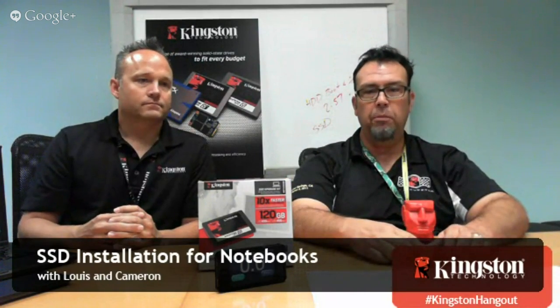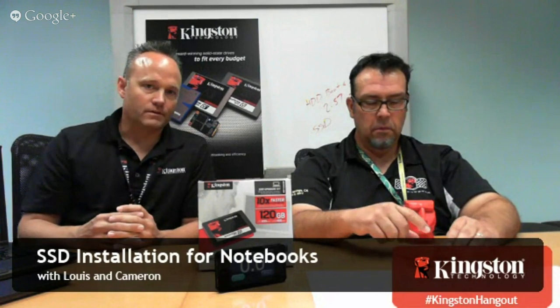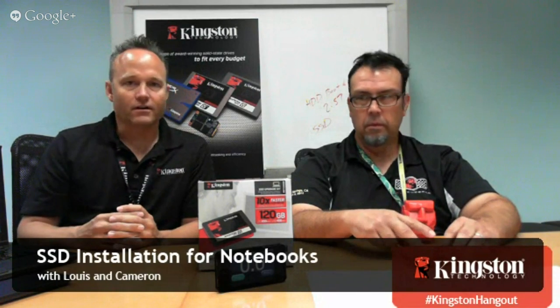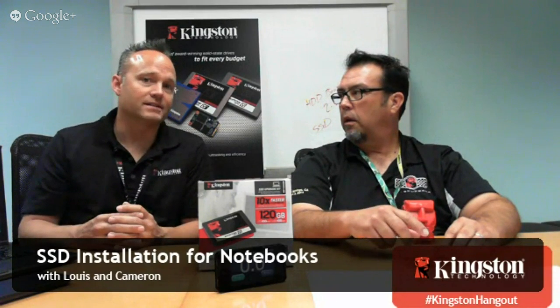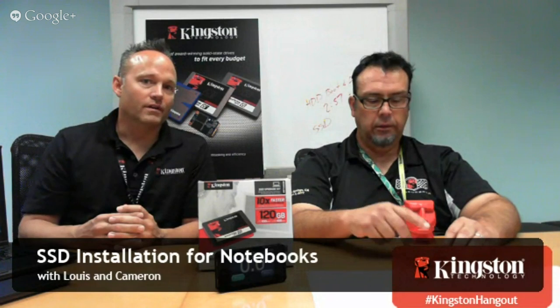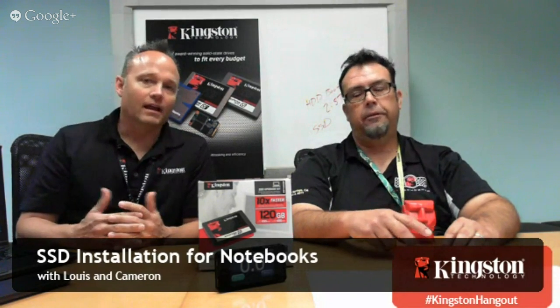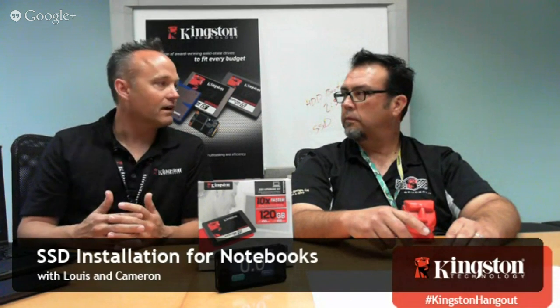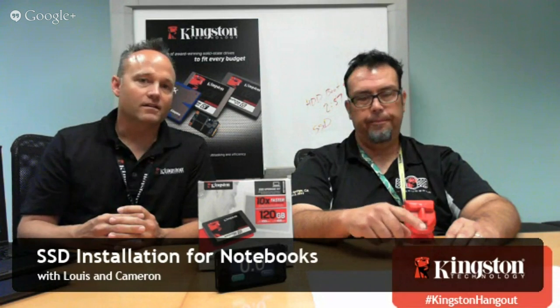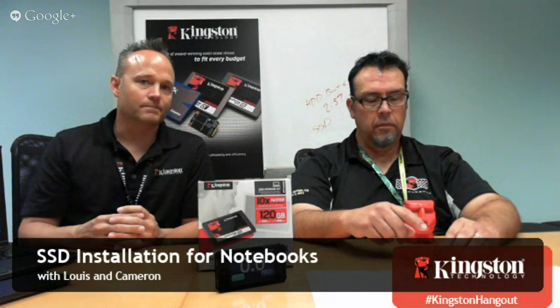I think with most SSDs, you'll see really good random read performance and random write. And then the other thing, to put some perspective on bandwidth performance with SSD compared to hard drive: with the latest generation of hard drives in the marketplace, we're getting about 100 megabytes a second out of the drive, with a port that's capable of 600 megabytes a second. And with an SSD, we're almost fully saturating that port at over 500 megabytes a second. So it's many times faster than a hard drive.